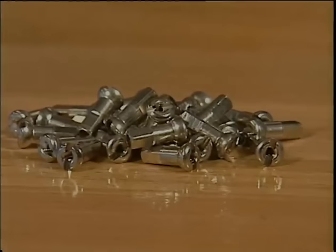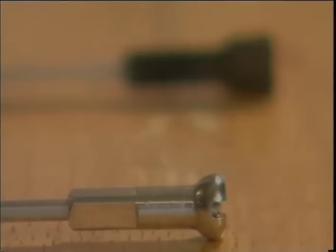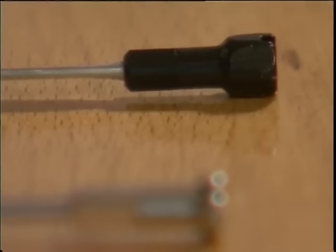In high-end wheel building, we work with two different nipple heads. The round head nipple is most common. This is the hexagonal head nipple, which is used for extremely high spoke tension, especially with wheels with a reduced number of spokes or with V-profile rims.